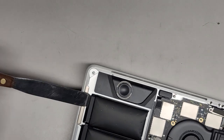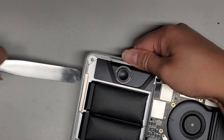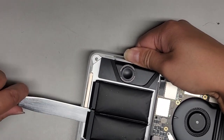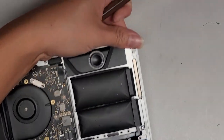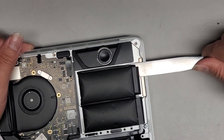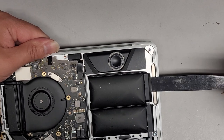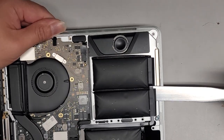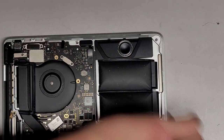We're going to scrape out the battery — get underneath like this and cut into it. You want to only go straight lines; you don't want to try to pull it sideways. Just go like that and continue just like this. Go down to the other side and do the same thing, cutting this as well. Continue going like this — this one's actually cutting out quite nicely.